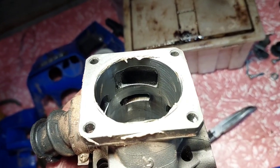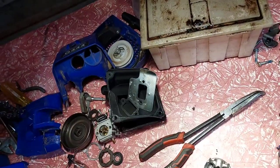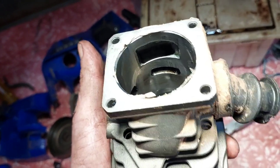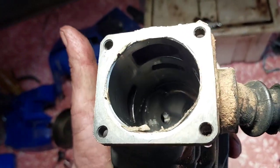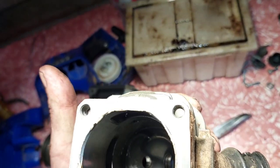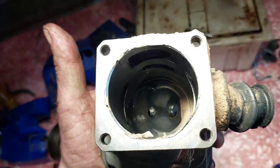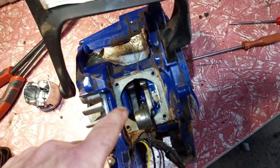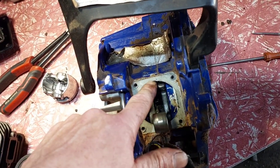I'm going to take that lower transfer there on the right hand side towards the exhaust — that one there towards the exhaust on the left hand side — if I want the air to flow back into the upper transfers back towards the carby. We've done a squish test, and I can't take that gasket off, otherwise it'd be 5 thou squish I think. Because with this piston and gasket here, it said 25 thou squish. If I remove that, I'm in trouble with squish.